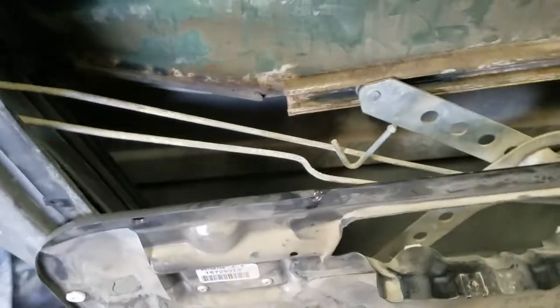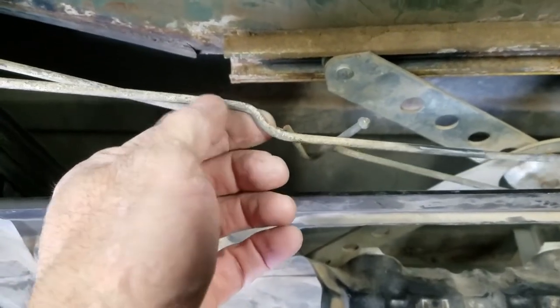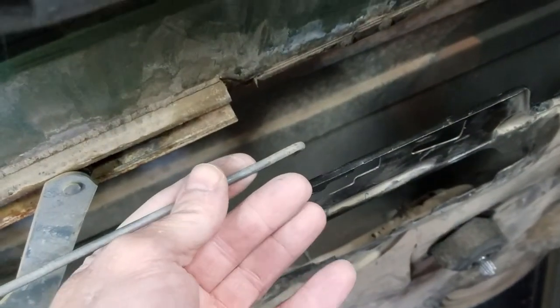Run into a little snag. Turns out the door handle itself — that's not really the problem, it works just fine. It turns out here at the end of the door, where these parts connect, they're kind of worn out. So it's a whole different part of the door that's not working. Temporary solution: the only adjustment I could do is right here — this little zigzag was a lot less substantial, just a slight bow. I've made it more drastic so the end of this is further back, meaning when I open the door I won't be binding on the stop built into the door handle — it'll actually let me pull the bar a little further. This is just a temporary fix; I'm going to have to find these end pieces.